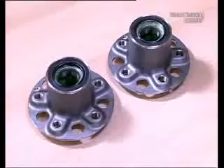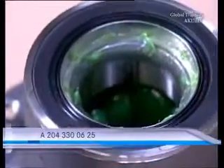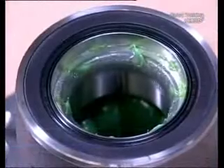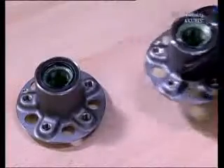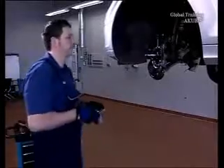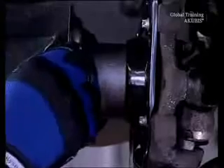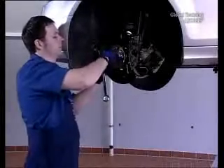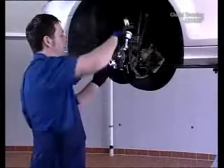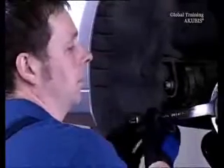Now the new wheel hub comes into play. The stainless steel bearing race is new. On installation, the ring is automatically pressed onto the corroded bearing surface of the wheel hub sealing ring in the steering knuckle. Push the wheel hub onto the front axle spindle — caution, the wheel hub may not be offset. Then turn the clamping nut until the wheel hub hits the block. With that, the stainless steel bearing race fits correctly on the bearing surface.